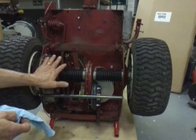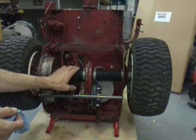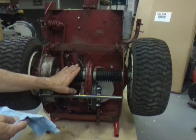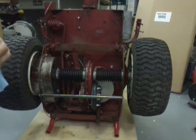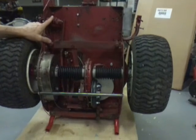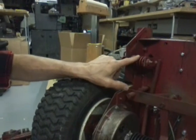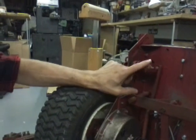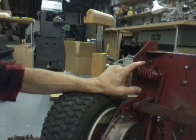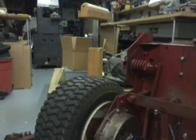So I got my grease in here, and in the chain case I got that hex shaft greased. That's ready to go. So now there's a grease fitting here. Let me move this. This is the spring and shaft on your shifter. You want to grease that. Otherwise that's going to lock up on you and you're going to have problems shifting. Okay, let me tip this thing down.